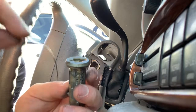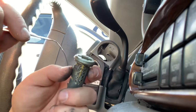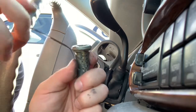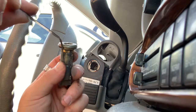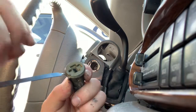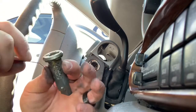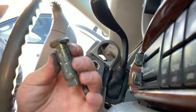So you can see our sidebar right there. What I did with my pick — here's the sidebar right there — that's your security feature to get it to turn. Got my pick in there and you put pressure on it. My pick is pretty much lined up perfectly with the sidebar inside the housing. You put pressure on and then just start raking it like a house lock, and eventually the wafers will sit in place and the sidebar will sit down and you can turn it, poke and pull it. So there's that — we'll go make a key and we'll be right back.